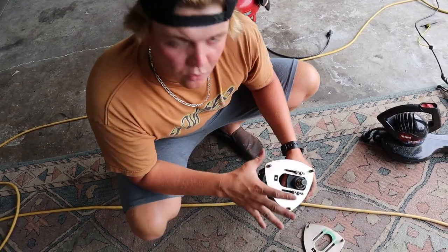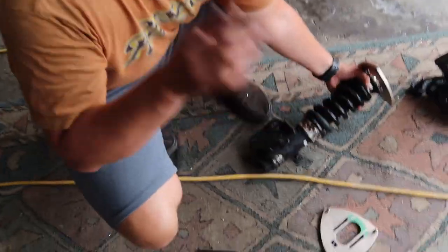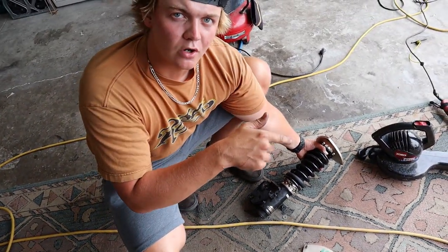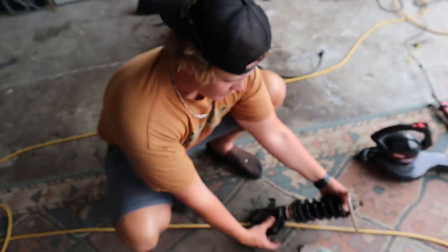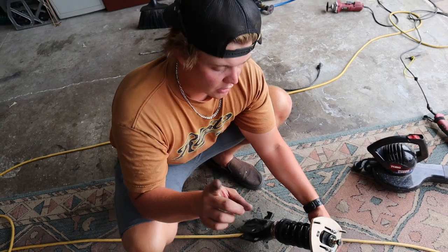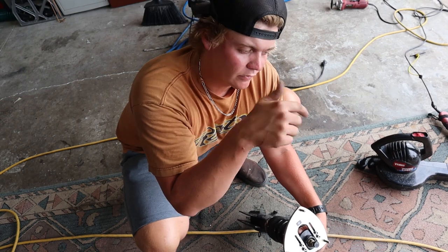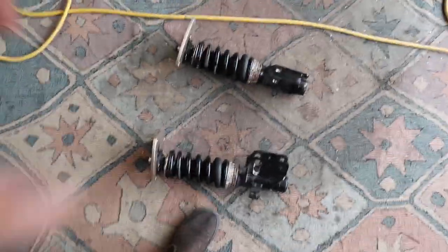This is gonna give you up to about -5-ish. So if you don't get lower control arms, but you are going to slot your coilovers, like we did, I'll drop that link down below. We did Charles' car, so you guys can watch the process on that. But if you're gonna do slotted coilovers for camber, I would also suggest, if you're not going to do lowers, to also slot your top hats to even out some of the camber from the lower part and upper part, just for axle bind.